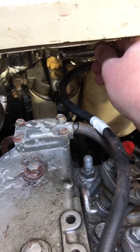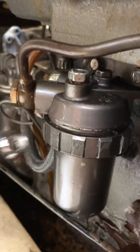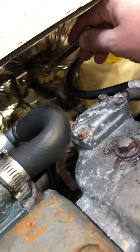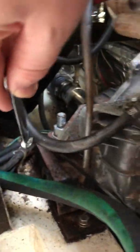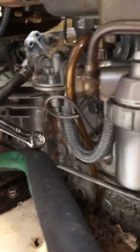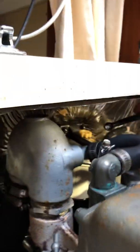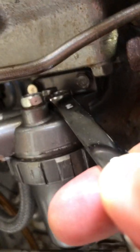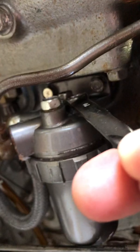What I didn't realize at the time — it could have saved me an hour — is that if I close this valve and then open the bleed screw on my secondary filter, not the front but the back, I can still pump the primary fuel filter pump and get fuel leaking out of there. I opened that bleed valve and pumped my primary fuel filter pump, and I got fuel leaking out of that, which was amazing. I got air bubbles and all kinds of stuff. It could have saved me so much time.